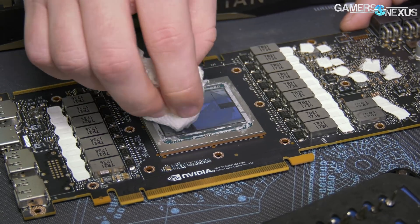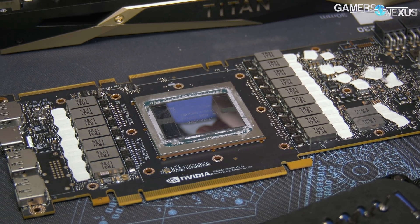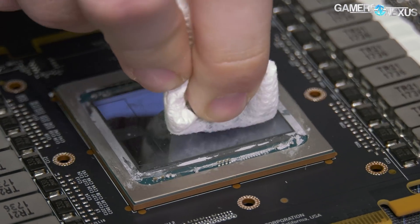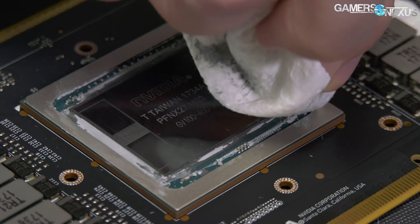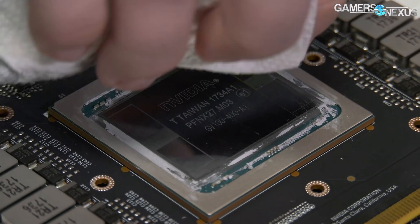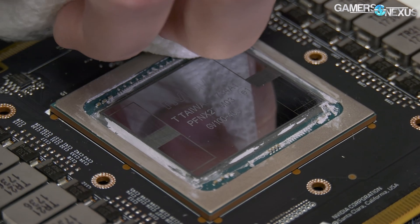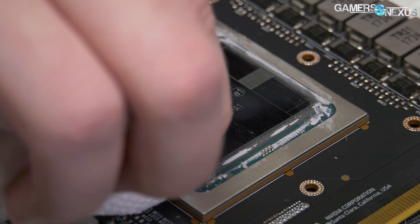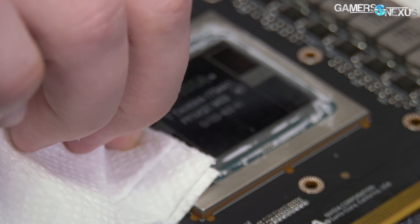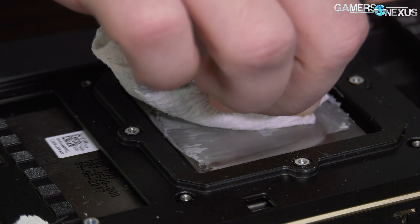That should be clean enough for now — we don't really need to get the stuff out of the corners and risk scratching capacitors. So that's the Titan V GPU. This is a Taiwan-made one, it is called GV100 — known as 400, and it's an A1 revision, which means it's one of the first production revisions. The spacing you see between the HBM is effectively an epoxy resin that brings the surface of the interposer all level with the HBM and the GPU. We can't see the interposer right now — it's underneath that epoxy resin, which is a protecting layer. Interposers are actually very fragile — if I were cleaning paste with just my fingernail and the interposer were exposed, you could actually kill it. The epoxy resin layer helps prevent that.